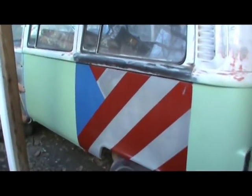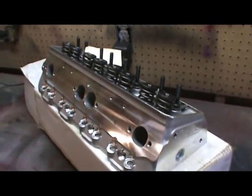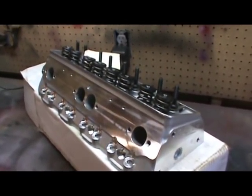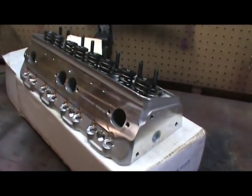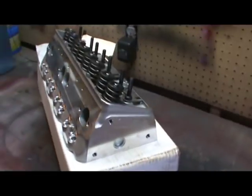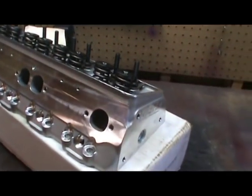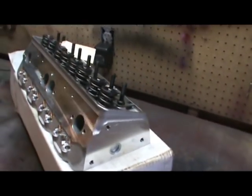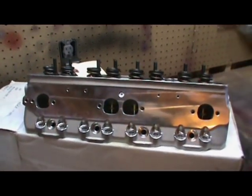Y'all can keep track of his progress on that. But I want to show you a new project I'm getting ready to start on. Here's what we're going to be installing. My dad, after he got sick, he built a small block 400 Chevrolet and put it in his pickup. The small block 400s were bad about blowing head gaskets, so he decided to get a set of aluminum heads from JEGS — dual valve springs, 205 intake, 160 exhaust, 72cc combustion chamber — hoping to fix it. But he got sick and that truck sat for years.